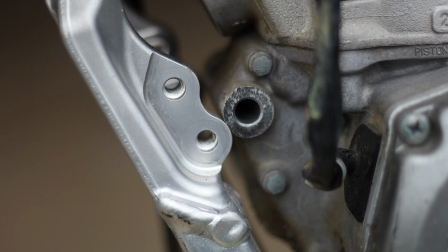In addition to that, where we left off last week, the front of the engine is resting on the RMZ250 chassis mounts, and so the engine can't roll forward anymore, and it needs to. So we're also going to go ahead and grind those suckers off. Once we grind those off, we'll be able to rotate the engine down or up in the front, whatever we need, and that will help us get some pipe clearance and also some air boot situation stuff going on in the back.